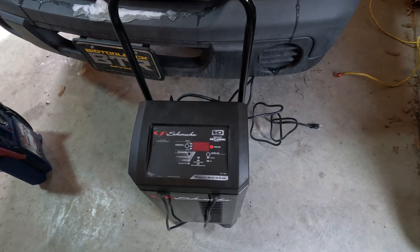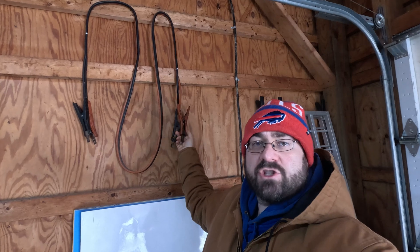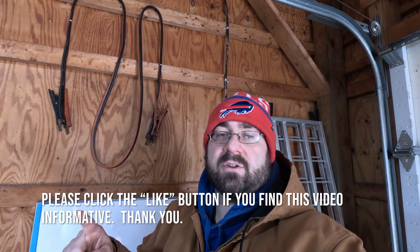Or if you're in the garage like this, a battery charger that allows you to jumpstart. Hanging here in my garage is what we've used forever to jumpstart vehicles, tractors, equipment. You've got two ends of a jumper cable, a negative and positive on both ends. You connect them to the dead vehicle first - positive on positive, negative on negative - then you connect them to the running vehicle, and that allows the power from the running vehicle to help start the dead vehicle. But like I said, today that is frowned upon - they say it's not great for the electronics of the vehicles.